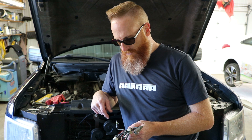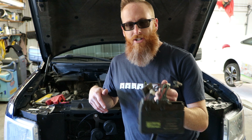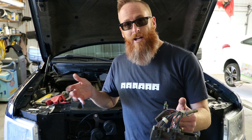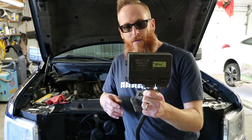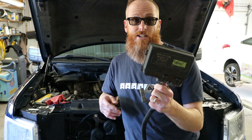If any of you guys have ever used a snow plow on a pickup truck before, on this particular one it's classified as an electric over hydraulic. Because you can't just go and mount a pulley with a pump on the motor anymore — well, you probably could — but this is so much easier. The pump and everything is electronically controlled outside of the engine compartment, so when you detach the plow from the vehicle you have no wires. You just unplug everything, tuck them back inside the grill and away you go. On these Fishers, you do have an isolation module which kind of controls everything from your lights to your power.